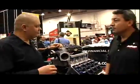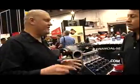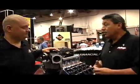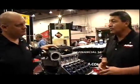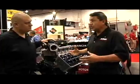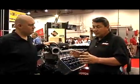When it comes to things that home builders or garage guys don't really consider — if you're cycling every fastener on an engine to get the torque right, that's a lot of time. So you can save time by not having to go through that cycling process. Some studs that go in at higher clamp loads — like diesel truck applications — require cycling maybe three times at 245 foot-pounds. Your arm's real tired. But the more important thing is still the consistent clamping load.